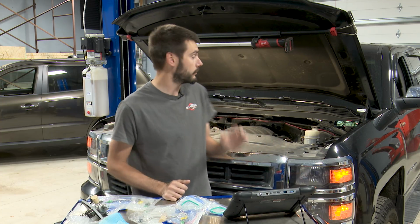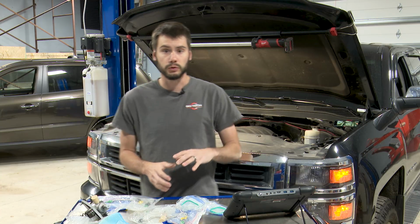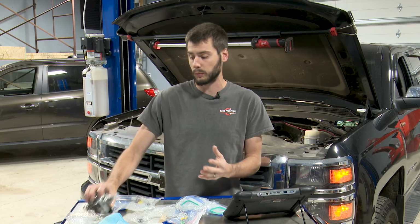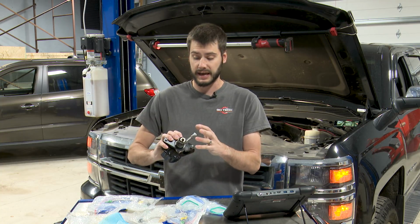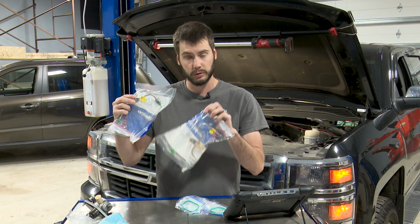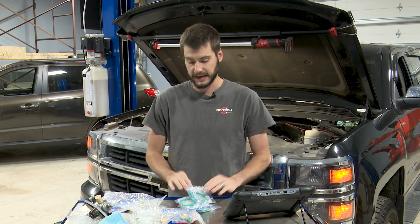So what we have to do today, we have to remove the intake manifold, remove the sound insulator baffle that sits underneath, unbolt the high pressure fuel pump, make sure the engine is in the proper position so that when we bolt this guy in, we don't wreck the cam or this fuel pump itself. And then get everything else replaced, including two different pipes here that we're going to be replacing and the intake gaskets. If you're looking for part numbers on this stuff, check down below in the description, okay?